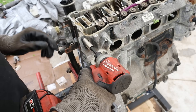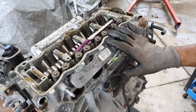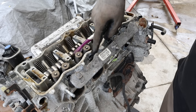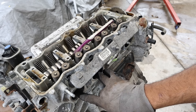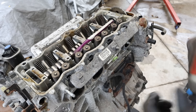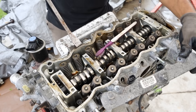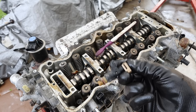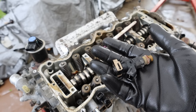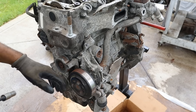This is the cam position sensor. This is the last of the era of port injection — essentially low pressure fuel comes in here and the fuel rail distributes it through these injectors directly into the airstream as opposed to in the combustion chamber. Therefore you won't have any issues with carbon buildup. This was also the era of having cheap injectors that are easy to replace, unlike a direct injector which will cost you three or four times the amount.